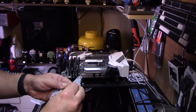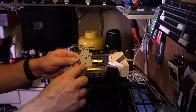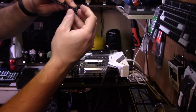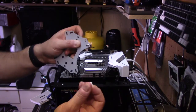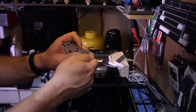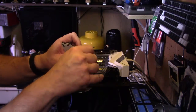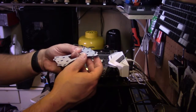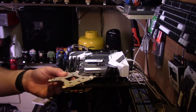Like you do with other Intel coolers, you have to put a spike through which comes through the holes on the board. On other coolers there are little lines telling you which socket to line up with — unfortunately with this one that isn't the case. What you have to do is place it through, make sure the back is flat, and for socket 1200 it needs to be pushed as far to one end as you can. Then there are little tiny plastic washers which you screw onto each of the little screws pointing through.